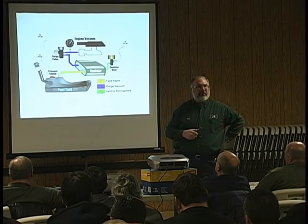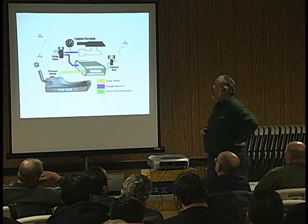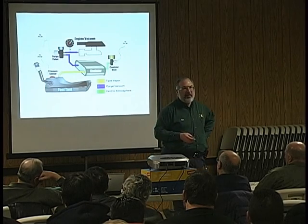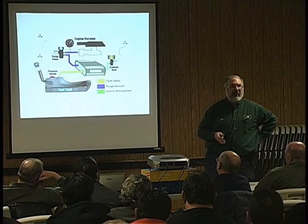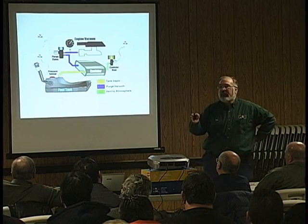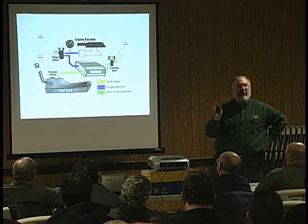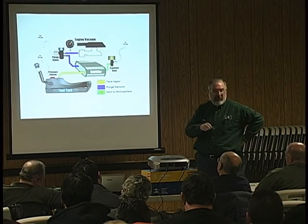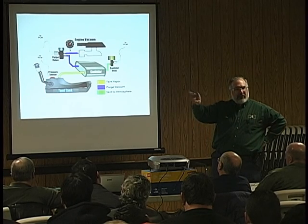Any further questions? Yes, sir. You have to check your scan data or your emissions to find that out, whether you have a regular solenoid. I found out the hard way on the Ford that it's pulse width modulated. So that's something, as you said, you're anxious to get the billable hours. So you should check to make sure that it's either pulse width or just a regular solenoid. But it was mentioned under the description and operation section.